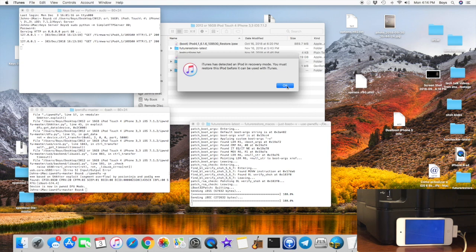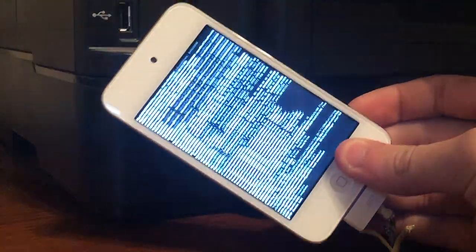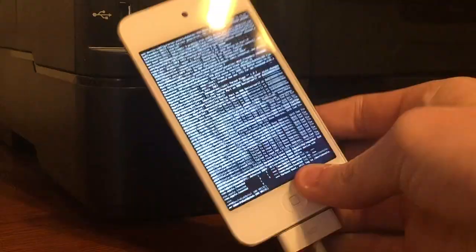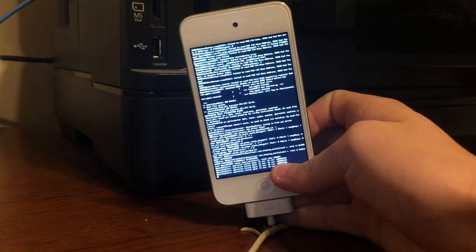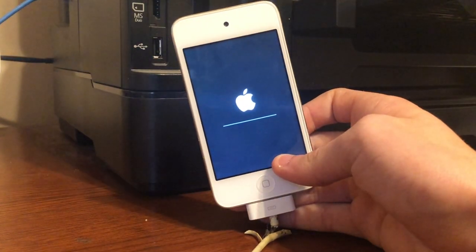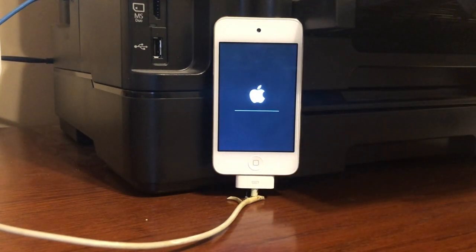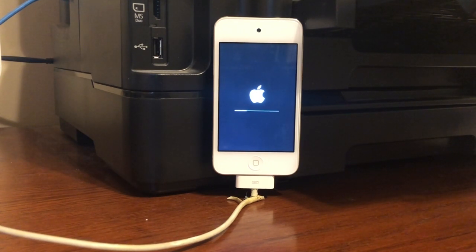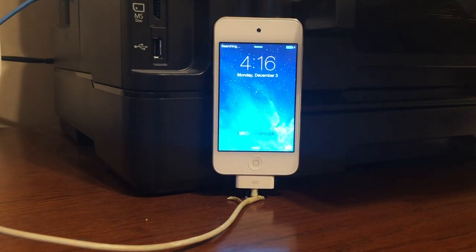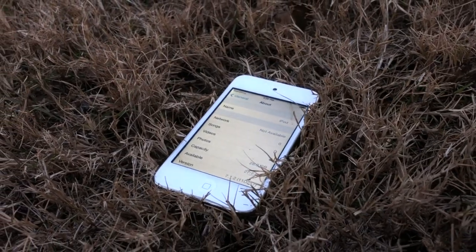What's happening now is your iPod Touch is booting into iOS 7.1.2. You should get the detected-in-recovery-mode error, then the iOS 7 Apple logo along with verbose text. As you can see, it is booting up. The first boot is always the longest, so keep that in mind. Congratulations — you are now running iOS 7.1.2, the latest version of iOS 7, on your iPod Touch 4th generation, which does not officially support it.